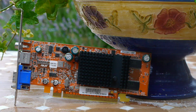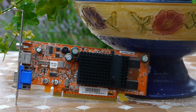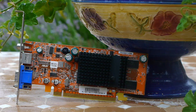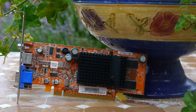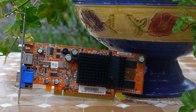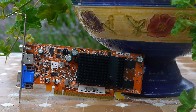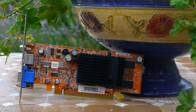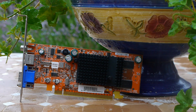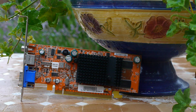I'm not going to claim it's perfect — 1080p desktop usage on an OS like Windows 10 with transparency enabled can be rather sluggish, especially dragging around hardware-accelerated windows like Discord. But you can't fault the card in lower resolutions like 720p and 900p; there's no lag associated with these tasks, and when you turn off transparency or use an OS like Windows XP, you can run it in 1080p absolutely fine. Those new operating systems can be a bit of a pain to install drivers on, but all you have to do is install an INF file. All in all, I've enjoyed my experience with the X300, and I've even used the mobile version on the first laptop I ever really had, which was still remarkably usable.